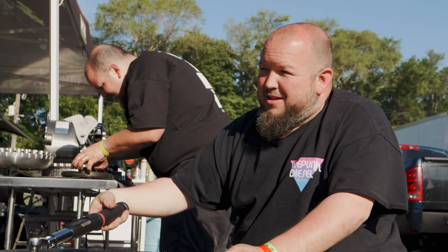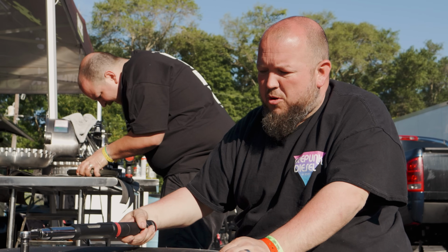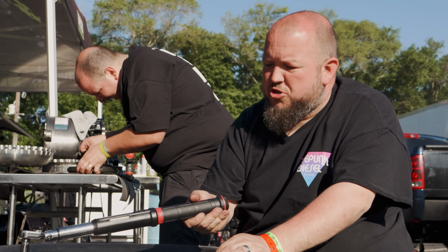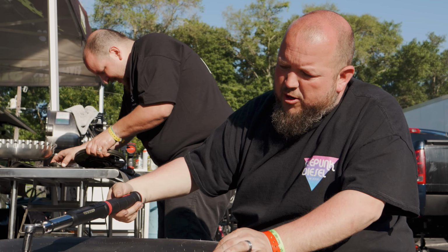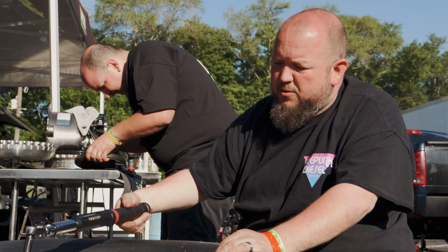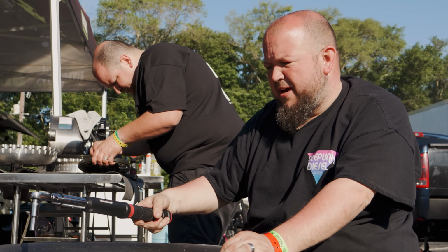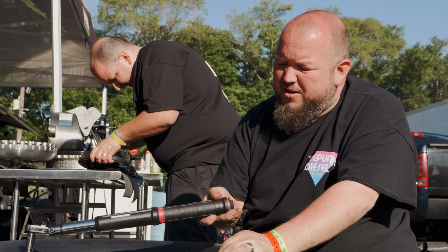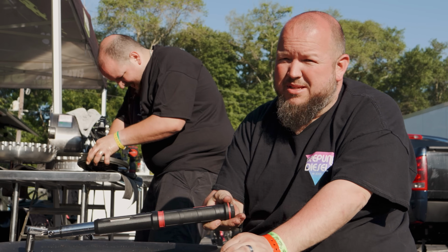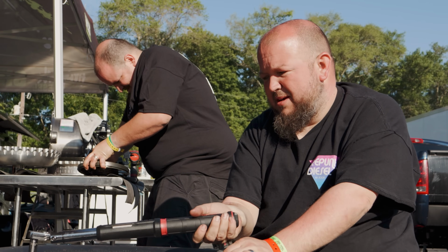He said, you know, it means the stator's too tight. So if your engine gets dragged backwards like that, then you've got too tight of a coupling between the engine and the tire. And that may be part of our problem with tire shake. So we decided we are going to do a stator change this morning. We're gonna go a step looser on the stator, and we're gonna put our tune-up back in it. We're gonna see what happens. I feel like it's a little bit of a long shot to make it go down in one pass, but we're trying.